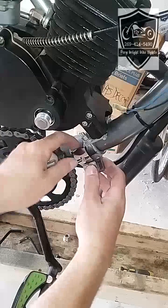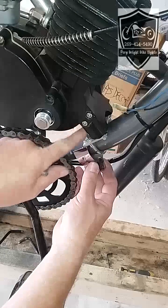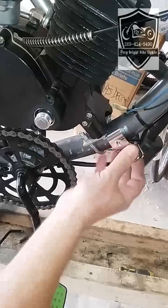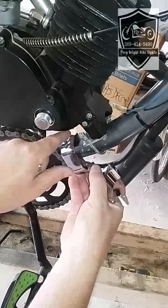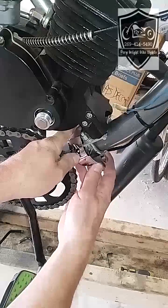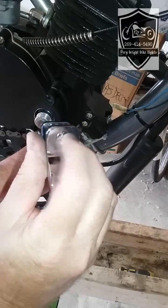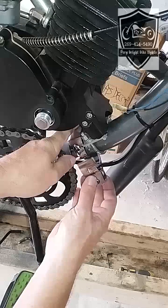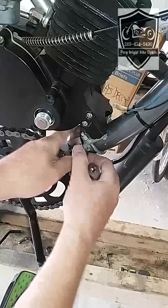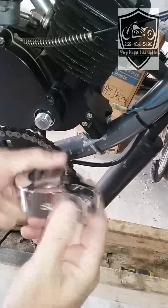All frames are going to be different and your engines are going to be mounted differently. On a motor mounted normally without the wide motor mount, you can mount it down here or up here — the only thing that might be a little difficult is clearing the muffler. That's why I choose to mount mine down here, because there's just enough room to squeeze in without interfering with anything. When you put this together, there's one side that's threaded — keep the threaded side toward you on the chain ring side of the crank, because there's more room on the other side to get to the bolt to tighten it up when you're done.